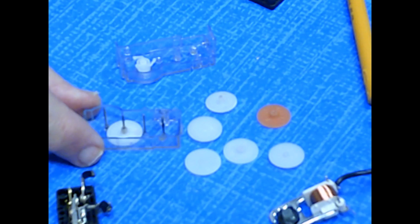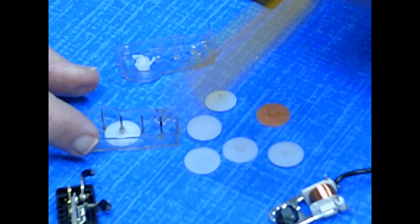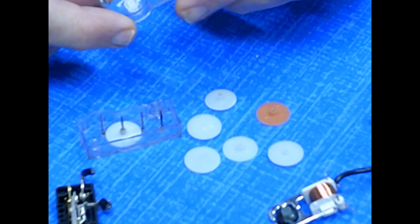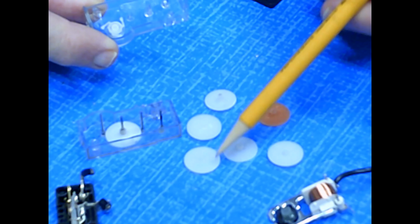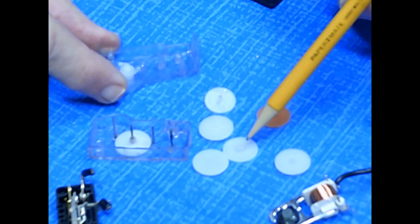It makes a sound as it goes around and around and around. My wife was complaining that the motor was making a sound. It was on continuously. That tells me it's someplace in the motor assembly. It wasn't just on when the switch was closed or open. So I'm going to assume that it is some type of defect in the gears. I don't see a defect at this time, but since plastic is one of the weakest parts of the construction, I would suspect that.